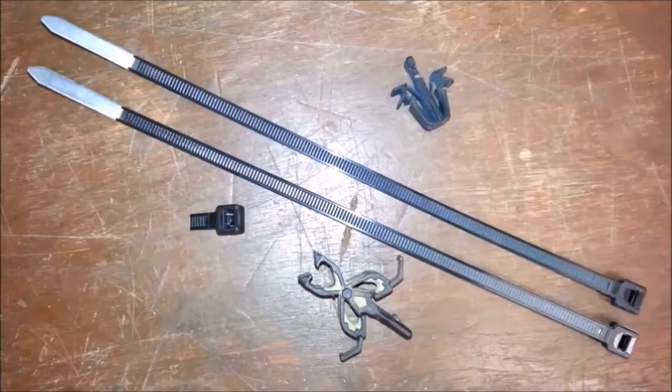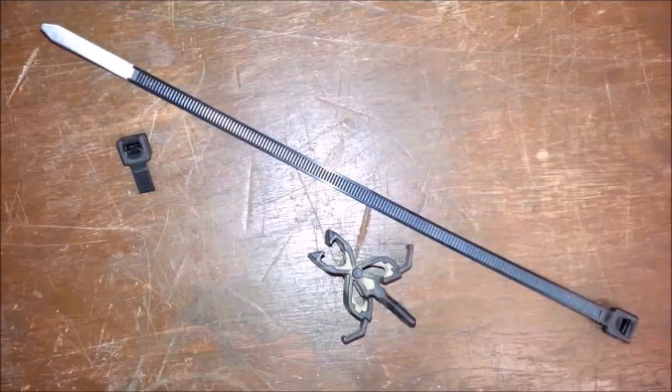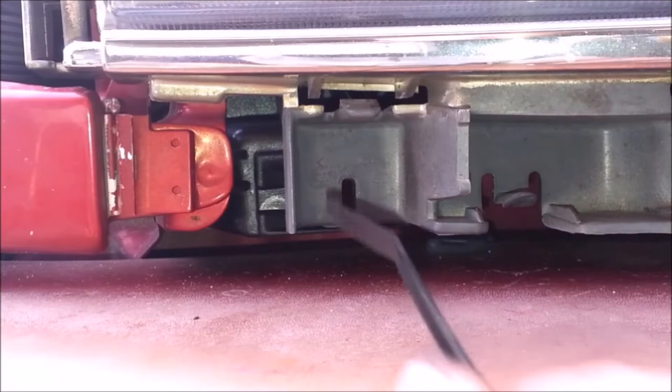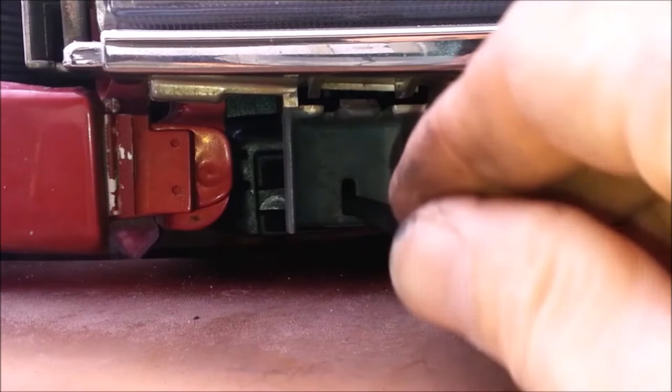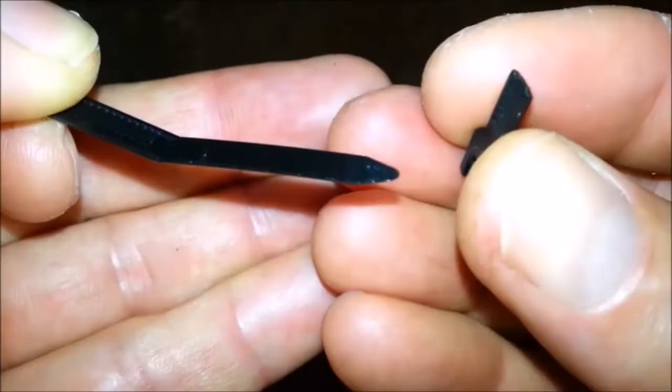If you don't have time or money to buy new clips, you can use UV-resistant cable ties for either type of clip. To use cable ties instead of the large clips, feed a cable tie through the grill where the long neck of the large clip goes, then feed the tie through one of the two slots in the headlight bracket where the jaws of the large clip normally engage. Cut the head off of another cable tie and slip it onto the back of the cable tie. Only engage a few clicks for now.